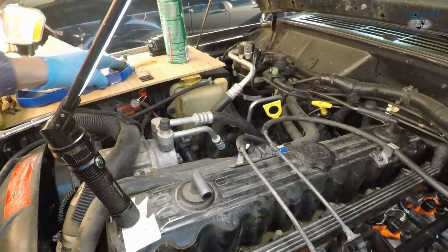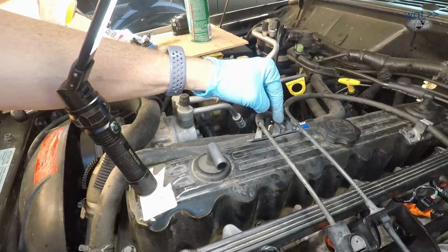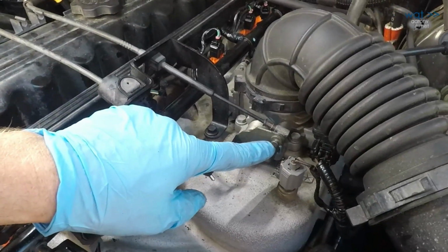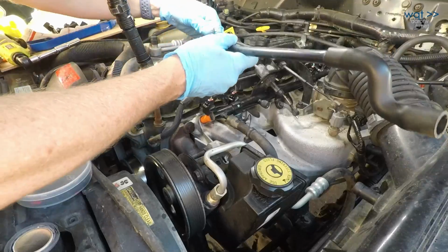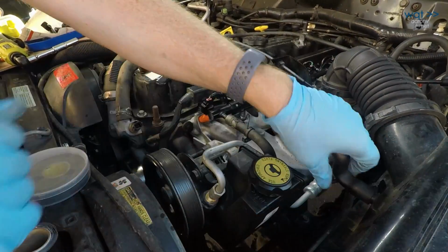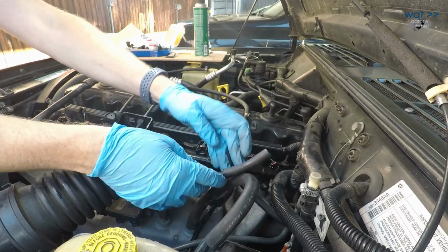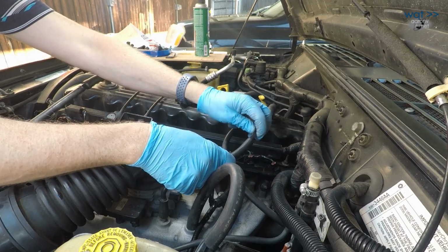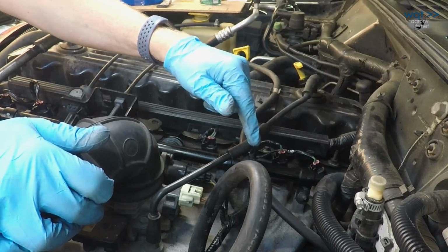If you had cruise control installed, the actuator would be over there, the cable would be coming over here, attached in there, and then clipping on right there, which is why there's that blank position. This here is normally one continuous piece of plastic, but due to heat, it likes to break here. So I just replaced that with a small piece of hose, and that actually makes it easier to get apart.